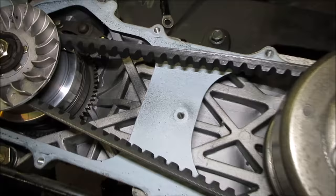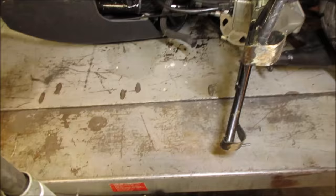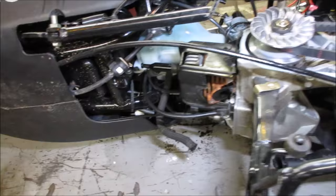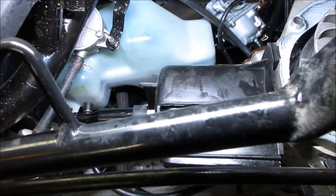All right, so we're going to go check next. We could probably put the ignition back together on the other side. I believe it came with. Here's the other thing too: what if it's got spark, but the spark's at the wrong time? Could be an issue. And then again, we can still have an issue with the inside of the engine being puked out and it just doesn't have any compression. Still don't have the answers.